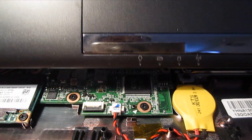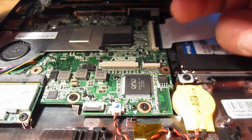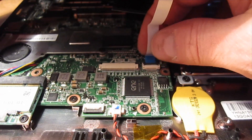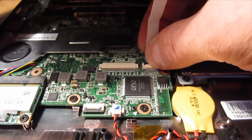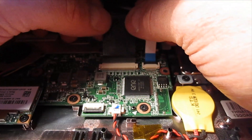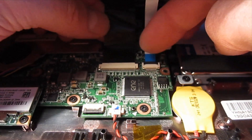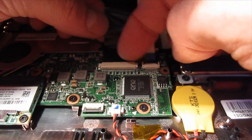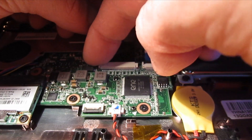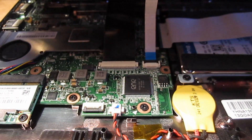I'm going to take the keyboard with the trackpad facing me and flip it up. The two ribbon cables have enough slack. This one here — push in and push in on the blue, and then push that right down. The keyboard ribbon cable — I've basically slid it in and I can take my finger and push in on the black tab on both sides and make sure that's in good shape.